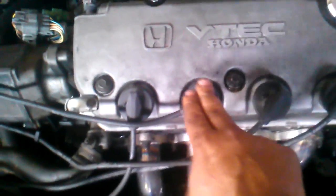I swapped one plug wire for the other to see if moving this plug wire to the other cylinder would make the misfire move — and of course it didn't. It stayed on this cylinder. So that definitely tells you something's going on with that cylinder. I actually changed the spark plug in this one and it didn't do anything — still doing the same thing.